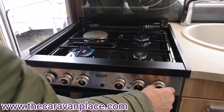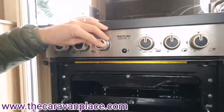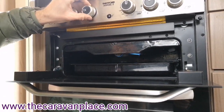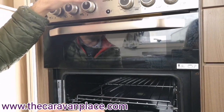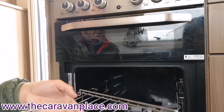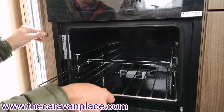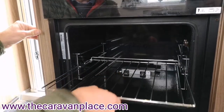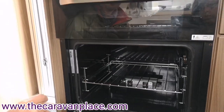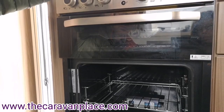We can physically see the gas coming through the system, which is why we normally do this first. While we're here we'll run the grill up — put it to the big flame, hit the igniter and that will light it up. Then the same with the oven. One thing to note: the shelves in the oven — the little parts should always be facing the back. That makes sure the shelves stay secure and won't fall out. A lot of people turn them around and try to use them as handles, which is not what you should do. We can then set the oven temperature from 240 right down to 160.